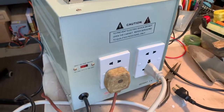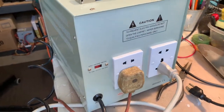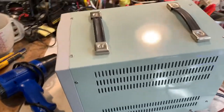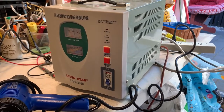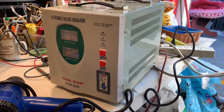It doesn't belong to me — it had a fault when it was brought into the shop. The fault was a loud buzzing noise when you switch it on. I opened it up and found a loose ground connection. The inside was quite fluffy and dusty.